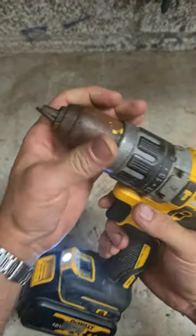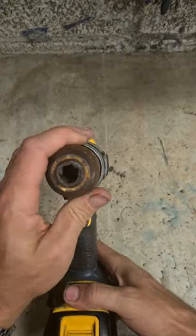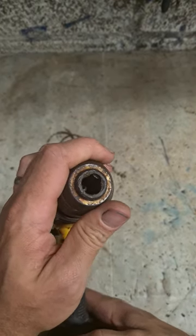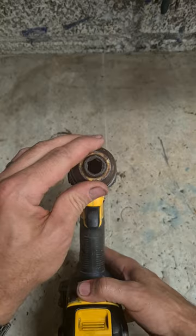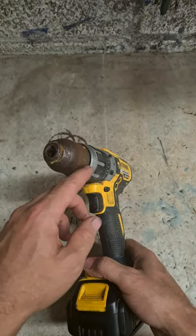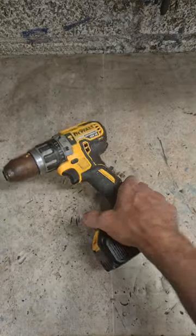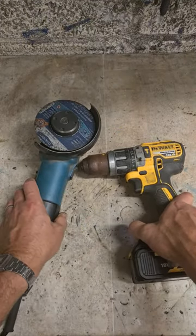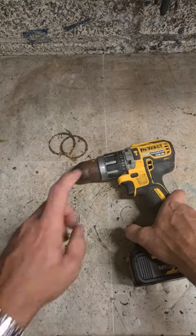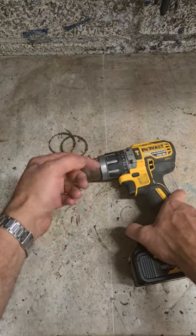The chuck's not sitting right. Inside the Dewalt there's no screw — no wee hex bolt or anything sitting on top. That's just part of the spindle. So how do you get it off? How do you change the chuck? Use your grinder — cut it off. Slice it down the side and then you can knock off the threads.